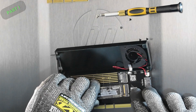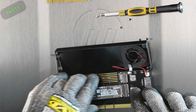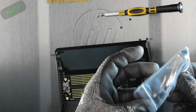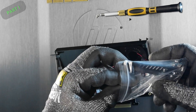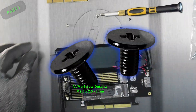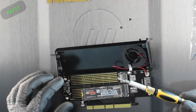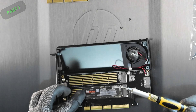The boot drive is a Samsung 970 Evo Plus 500GB — not the fanciest drive but it works really well. Inserting it gently, keeping an eye on the M key on the side. We need a standoff to mount it properly — luckily they come supplied with standoffs and screws.